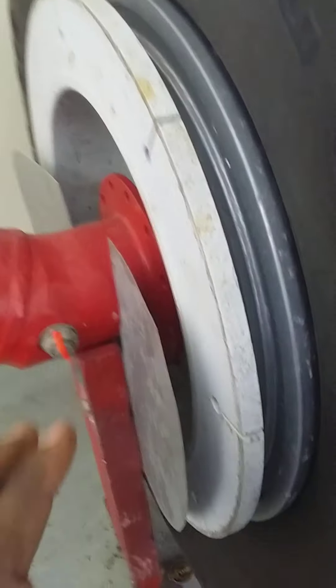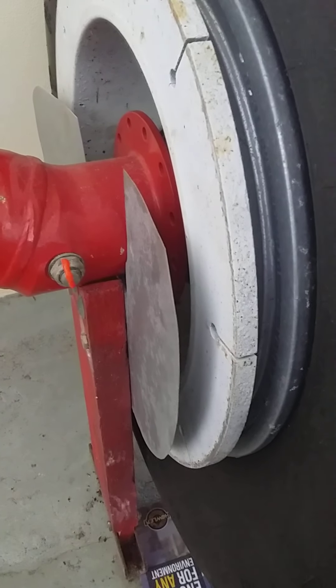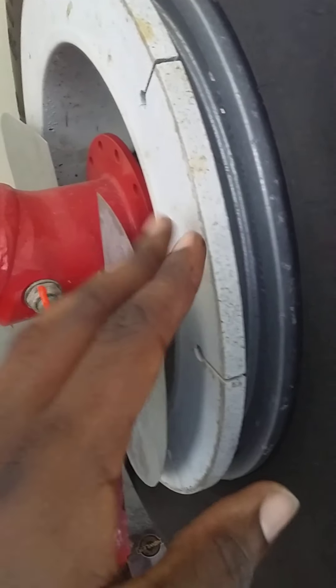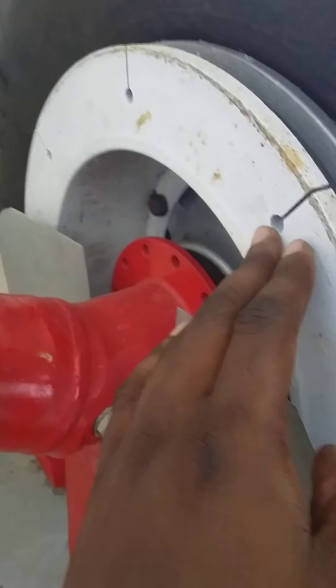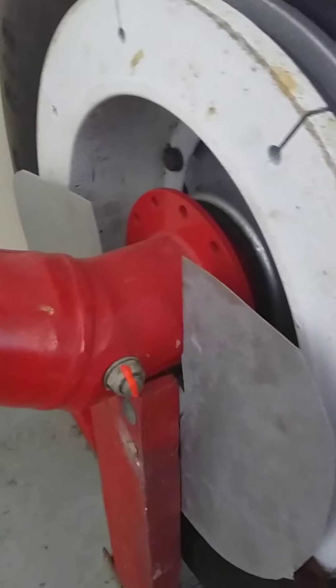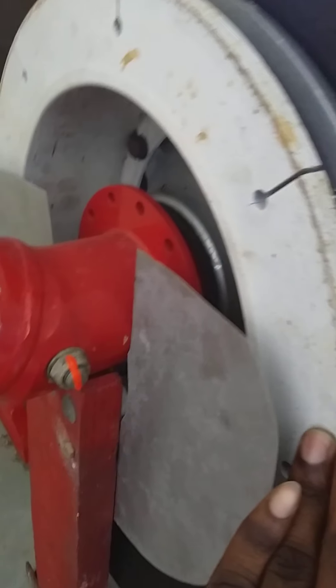From there I'll go to the back to get a brake caliper. I'll inspect my brake caliper for leaks and for security of attachment. I'm checking my brake liner and my brake disc for any cracks at the heat expansion points, and just for general condition — as you can see, this has some corrosion on it, but we'll allow that.